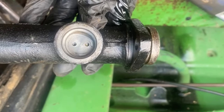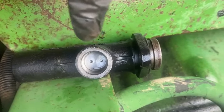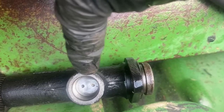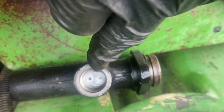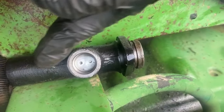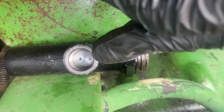This is the old one — this is the chamber where the oil sits when it comes from the pipe from the top reservoir. When the rod pushes the piston in you can actually see the piston moving; it ends near the top and there's an internal chamber on the piston. When it goes forward it drags oil in through that tapered hole and pushes it out to the slave cylinder, while oil is dragged through from the reservoir to keep a cycle — so there are no air pockets in the master cylinder, it's continuously cycling.